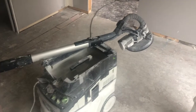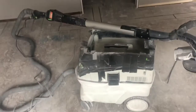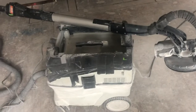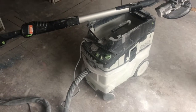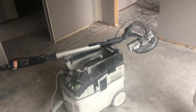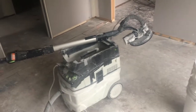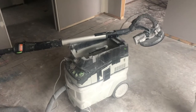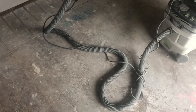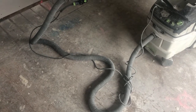So over the years, in this vac, basically, I had to replace the motor, and once I replaced the cable. Apart from that, nothing else, and also the filter, of course. Every year I was replacing a filter, so I was using the filter for 1 year, which is probably not such a great idea. It's probably best to replace it at least 2 times a year. The cost of a filter is $150, I think, at the moment. I haven't replaced a hose, so it's a pretty durable hose.